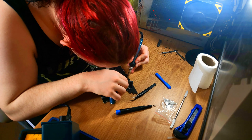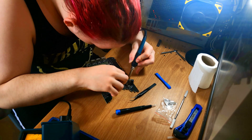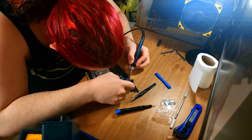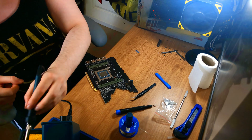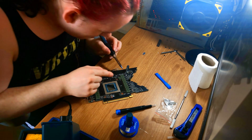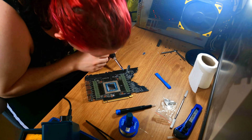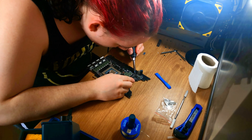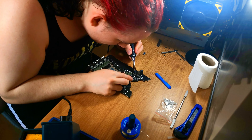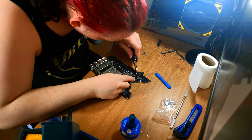In order to work out how much power you want, if you are doing this — and this is Founders Editions only, since you cannot put in a different VBIOS, which means you must replace the resistors to increase power limits — you can use a shunt resistor calculator. There is one available as a download, which I'll post a link to. Do this at your own risk, because soldering and physically changing the hardware on your board will invalidate your warranty, as I mentioned at the start.